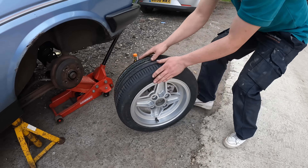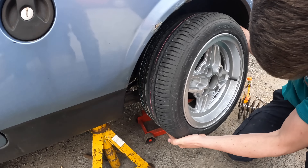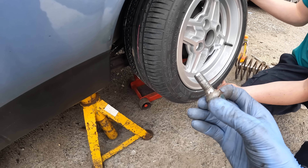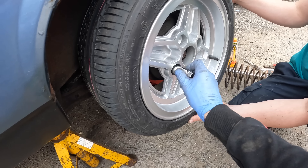We're going to have these fresh wheels — look at them, they look so good. I've also brought him round some different bolts, because you can't use the steel bolts — you need to use the alloy wheel bolts. Not much different, but otherwise the wheels will wobble about like anything.